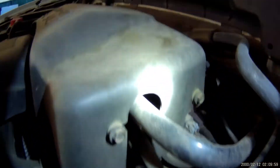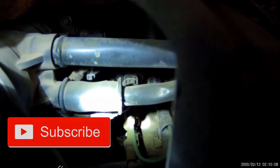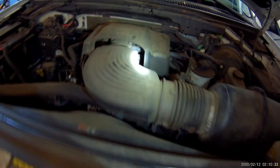The third component to the EGR system is going to be the EGR VSV — vacuum switching valve. That is under the cover, with the green vacuum line right there. Looks like you might have to take my word on it — right down there, really hard to see. But there's a VSV for your EGR system down inside there.